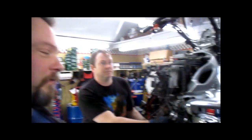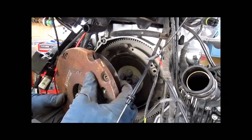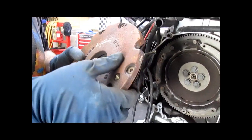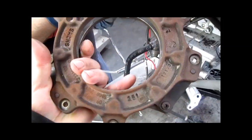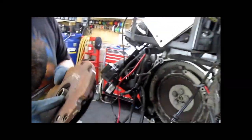Day 2. Our discs have finally arrived. We have our nice new modified clutch disc. One thing we're going to do with this particular R1200C is take the manhole cover off that they call a clutch cover. Look how thick that is — that thing is enormous. We're going to weigh it and replace it with this whole lot lighter one. So let's get this weighed up.